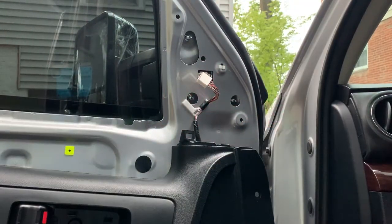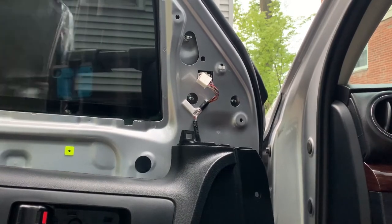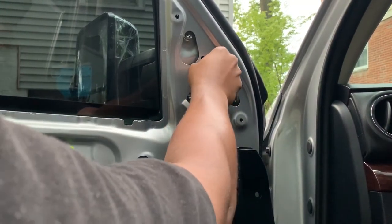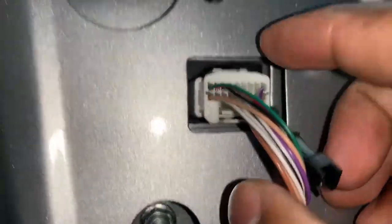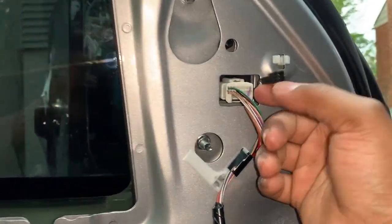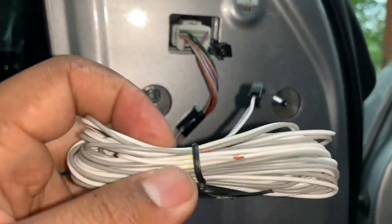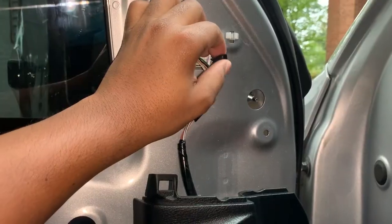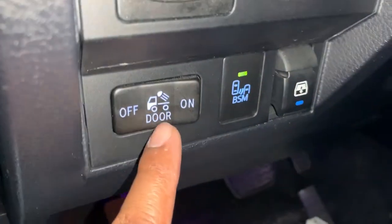Go out there and make sure it's tight. She's tight. Now let's go ahead and plug this in. She's in there. I got this bad boy installed — just plug and play. This wire here connects to this wire: the white is positive and the gray is negative. What I was advised is that many people connect it to the feed of your truck bed light, so that way when they turn that on, that light comes on and when backing up they can see, especially in a dark back area.